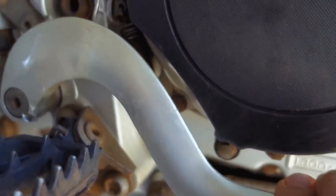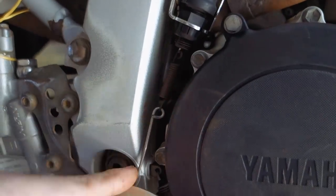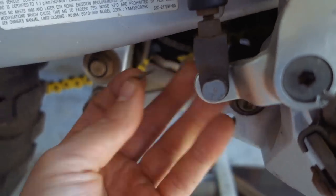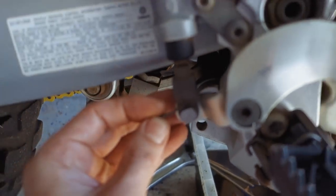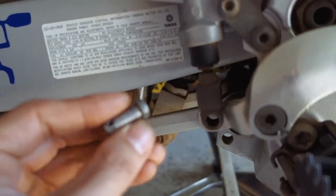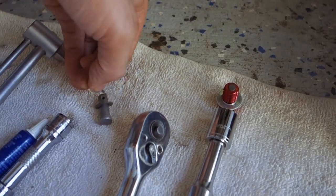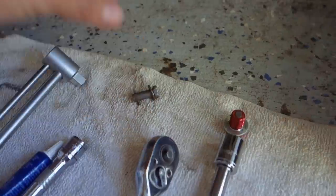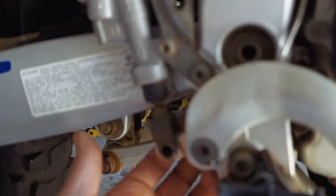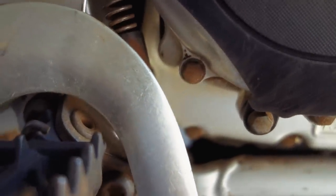After we remove the oil, we've got to take this little protective cover off. As you can see, the brake pedal is in the way - there's no way to get to that bolt back there. A lot of people say just take the brake lever off, but what you can do instead is there's a cotter pin - pop the little lever out, you're gonna have a little washer there. Keep everything organized - put the washer back on, stick the cotter pin back in. Now you can pull this little brake clevis thing and boom, you have the clearance you need to get to that 8-millimeter bolt. Saves a lot of time.